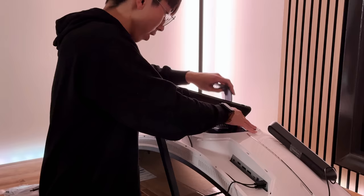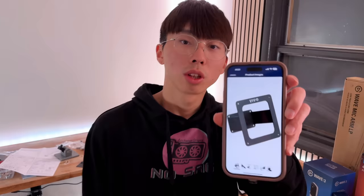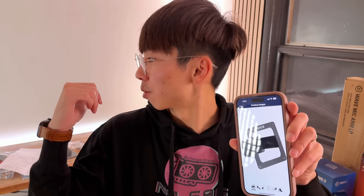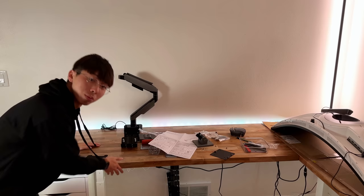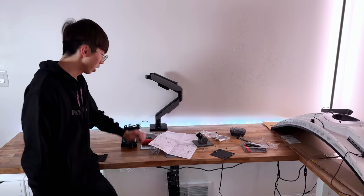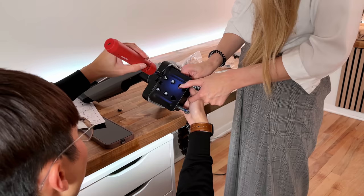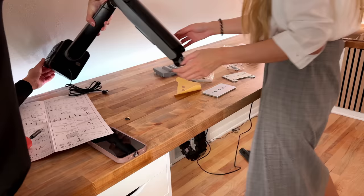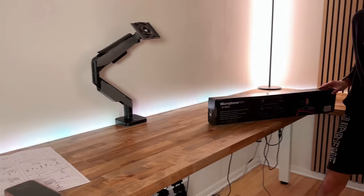Got these brackets off and there are four screws attached. Just going to remove that, hopefully the stand will come out. Looks like we need an adapter for the 49-inch monitor, so we're going to hold off on mounting this monitor arm to the monitor. I guess we can still mount the monitor arm to the desk first and then just wait for the adapter to arrive. The monitor is pretty heavy - if we put it all the way in the middle it's going to have too much stress and over time it's just going to bow a little bit. So I want to have it set somewhere near the leg so the leg can support the arm too. It's so sturdy.